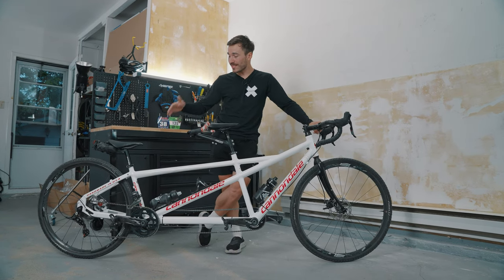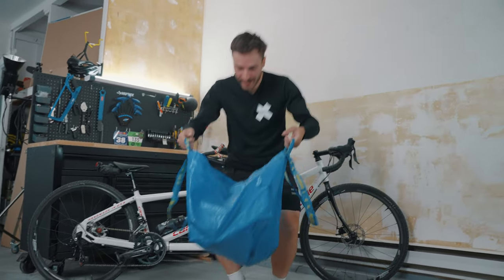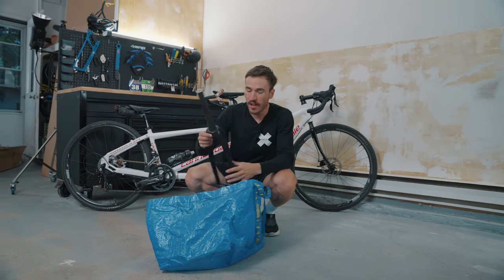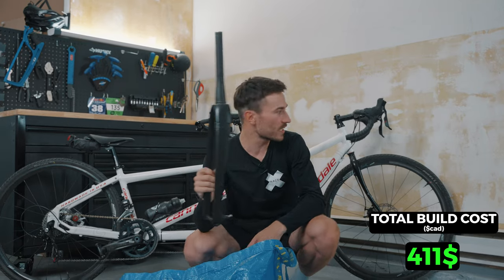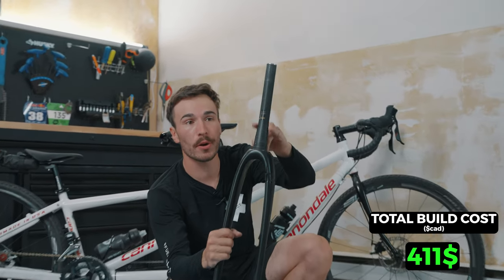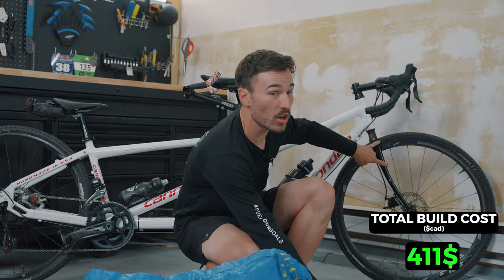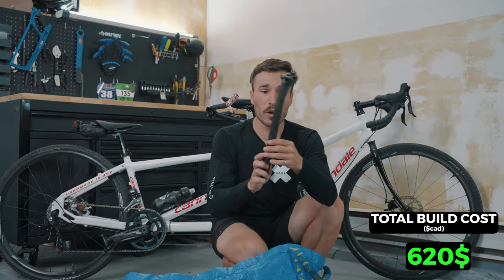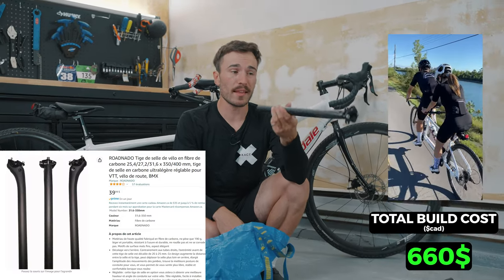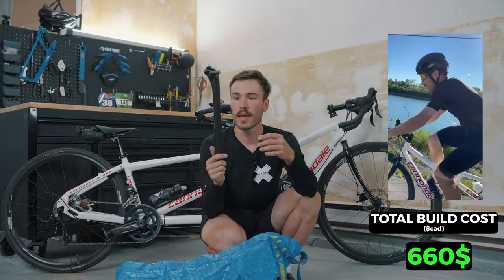I'm going to show you all the sketchy and innovative things about this bike. Here's a full bag of everything wrong that I bought. The biggest mistake of this build is this Envy fork that I paid 350 USD. I wanted a carbon fork for this build, but turns out this one was tapered and the headset was only taking straight forks. Instead, I went with a Surly fork. I also bought a carbon seat post for Gabrielle in the rear from Amazon — it was super cheap, and the reason it was cheap is because the sizing is wrong and it doesn't fit the 27-point-something millimeter tube.